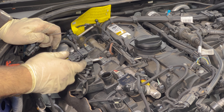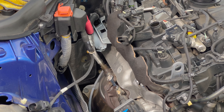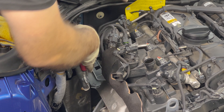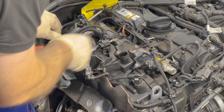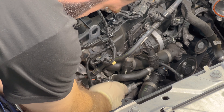This guy just clicks into that pipe and then this one clicks into it right here — it's just like an N20. Now's a good chance to go after the charge pipe. I just removed the clamp altogether. Following it up here, there are a couple more connectors. We have three T30s right here. This acoustic cover up at the front has to come out — you have push-style clips right there, one in the corner here. I'm going to unclip this; it pushes into there. Got two more push pins right here.